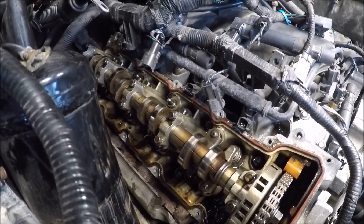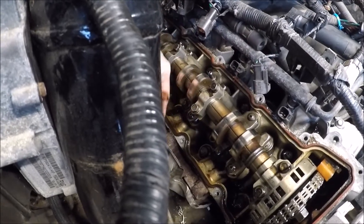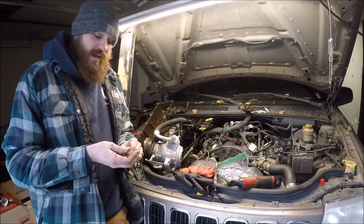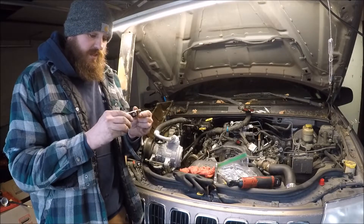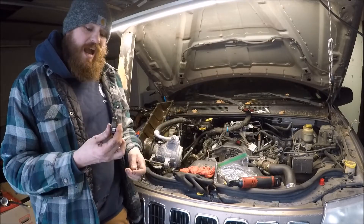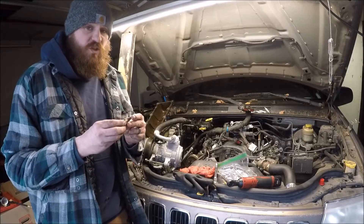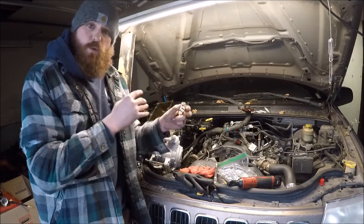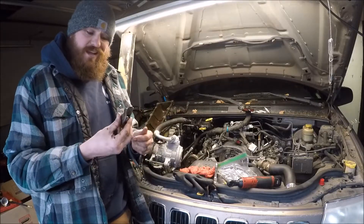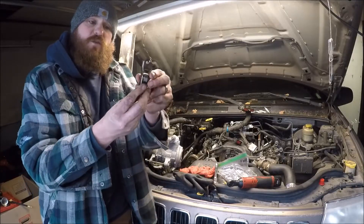I don't have to get further into this engine. I don't see any damage to the camshaft or to the rocker arm. I think I got pretty lucky here. While this rocker arm appears to be the only thing that has popped off and everything looks pretty good, I really wanted to figure out why these things kick off rocker arms or fulcrums, because it appears to be a pretty common issue with these 3.7 and 4.7 liter Chrysler V8 engines. I reached out to a few people, did a lot of reading online, and it seems it comes down to a couple of things — one could be poor oiling, just kind of a bad design.